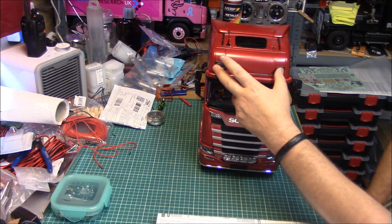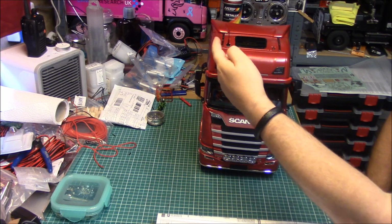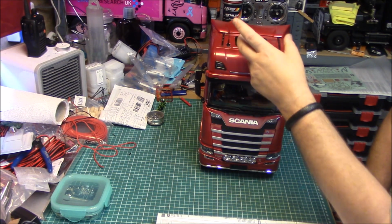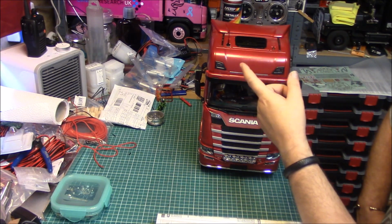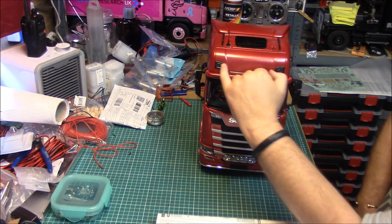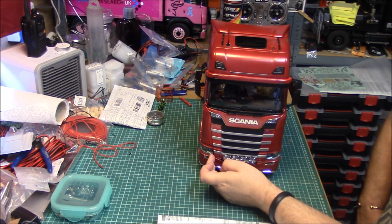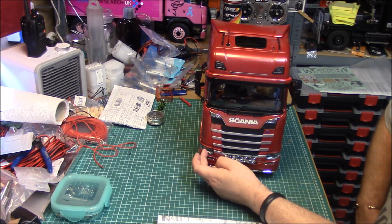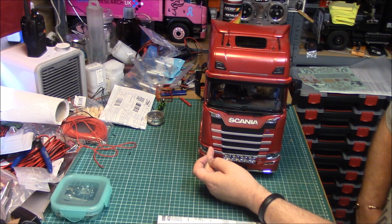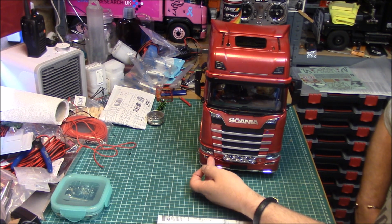So they've got 2 in here. They have the 5 in the roof, which you would normally have on, say, a night hauler or a king hauler. You've got the orange lights on the top, so you'd use them as spotlights, running lights, whatever, in the light bar. Then they've got these as auxiliary lamps. Then according to the book, if you're using an MFC03, main beam, 5mm. Headlight, 5mm. Indicator, and auxiliary light. So it's 4, sorry, not 3, 4 each side.